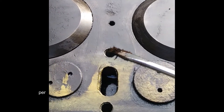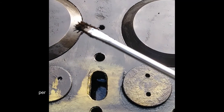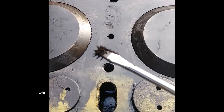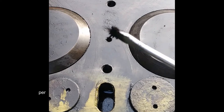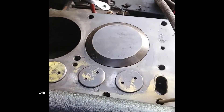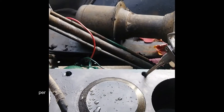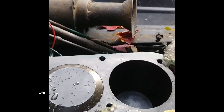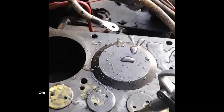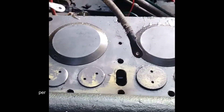After you finish cleaning up your work, clean the carbon off the tops of the piston heads, clean up your block, and make sure everything is clean. For all the bolt holes, take either a drill tap or a magnetic screwdriver, insert it down in each hole, turn it around about 10 times, then blow it out with compressed air to get the debris out so you get a good seating. Get all the water off as well.